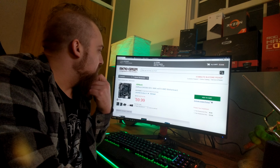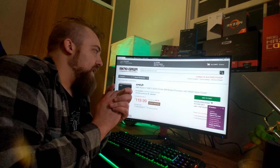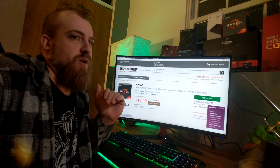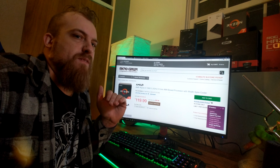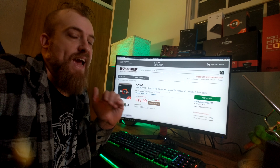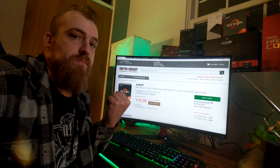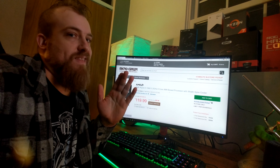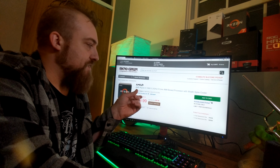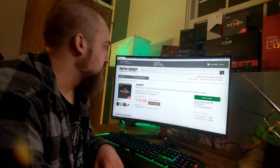Now, with that motherboard, I did go with the Ryzen 5 1600. It has 6 cores and 12 threads, so it's going to be pretty good in gaming. Now, this is a budget build, and I know you can get like a 2200G for around $80-$90 right now, but you don't want to do that because it does cut the PCI Express lanes in half, which will bottleneck that 2060. So this is about the lowest you want to go on a CPU. And I did go with AMD because they fit in a lot of budgets. So I think you're going to like this. And if you're anywhere near a Micro Center, they have an open box for only $95. So that could even save you more money if you're willing to go open box.